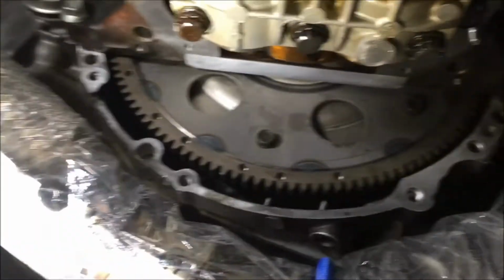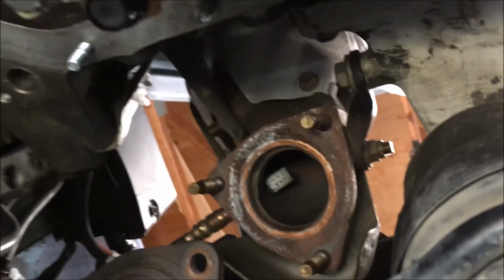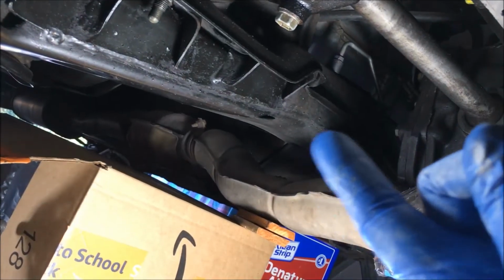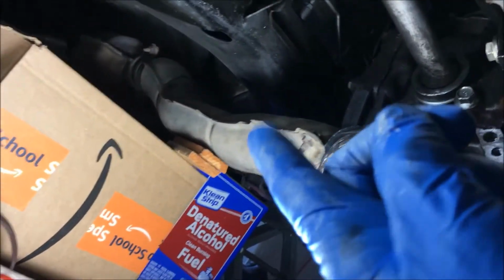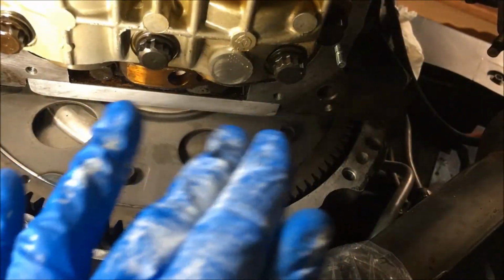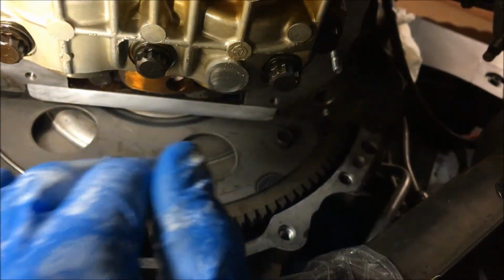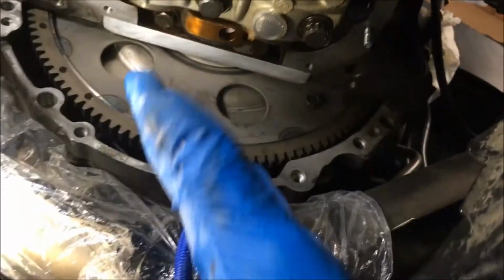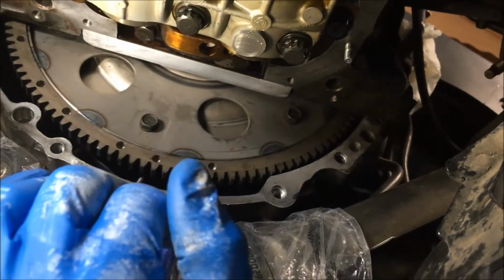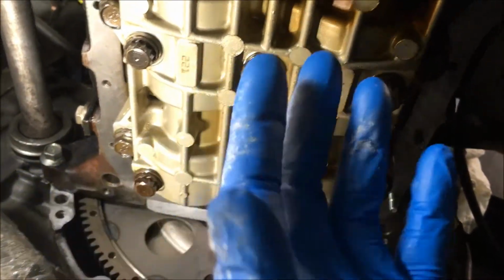It's not difficult, y'all. So were I to do this again, starting from the beginning, first thing I'd do is drop the exhaust, meaning the three 14mm nuts there. Release the bracket back there, the two 12mm, and it'll come down, have something to support it. Then I would remove the stiffener, which will go right up here. Then I would remove this plate with a piece of foam on it. The plate has pins on it that protrude out, that hold the foam on. So if you don't get those out of the way, it's real difficult to get that pan out because it drops and hits that. That would allow me plenty of room with this exhaust dropped down to release all of the bolts and the two nuts on the oil pan and just bring it right down. But she's gonna go in and have a good seal now.